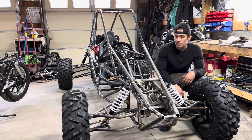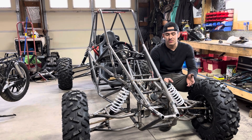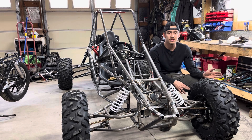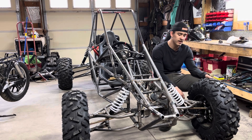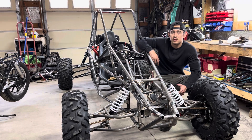I know we didn't get a whole lot accomplished in today's video, but we did get the front end re-situated and fixed. We've got the caster angle at an actual angle instead of it being perfectly parallel between the top and bottom control arm. We have the top one slightly downward a little bit, and we have the kingpin angle in the correct angle now. I probably didn't do that the correct way, but it worked, and there's no bump steer, and the tires are straight. We also got the radiator hoses on, and hopefully within the next couple of videos we can get this thing running.